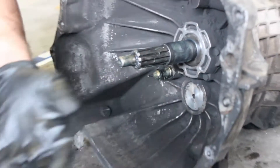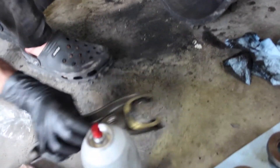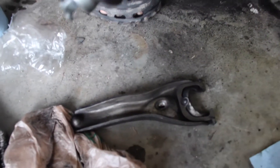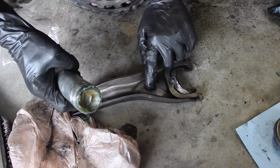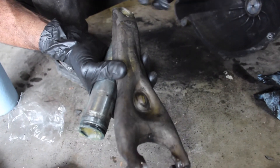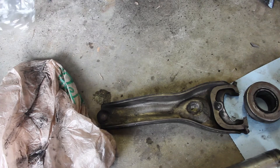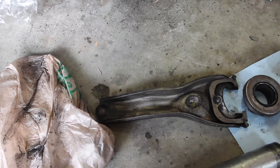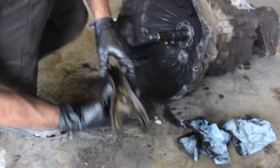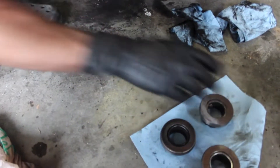I'm going to grease both points on the clutch fork - this is where your pivot ball rests against. I'll probably double-grease them even if it's not strictly necessary. I'm also going to grease the back side of the fork where the rod from the hydraulic clutch is going to push in. Now the way this goes together - this is from an '89 GMC 1500 so it applies here too. The clutch fork has an indented portion that goes on the male part of the pivot ball like this.